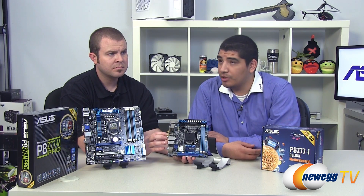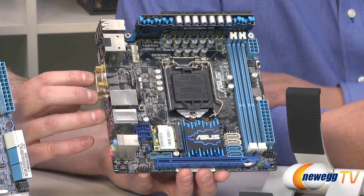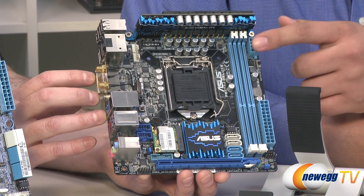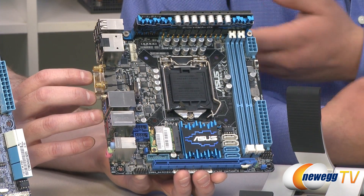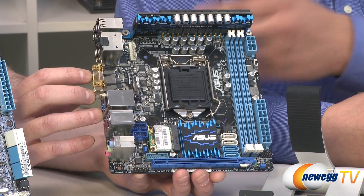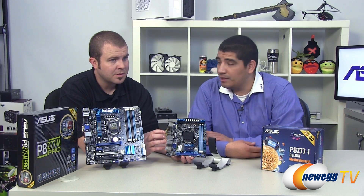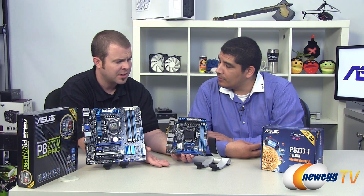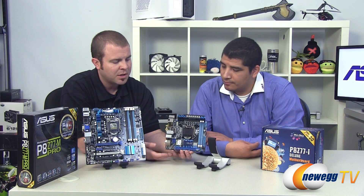Expansion is still really solid. With 90% of the market using only one graphics card, you could use the iGPU or expand using the physical x16 slot for a full discrete graphics card. You can also add an 8-channel-capable TV tuner or a high-performance RAID controller — it really depends on your usage model. We have our high-performance T-topology memory design, and this board has already been validated up to 2800MHz memory frequency, up from an initial 2400MHz. With 4.8GHz overclocking on air and 2800MHz memory, it performs just as well as our desktop boards — showing the work we've done to make this mini-ITX board special.